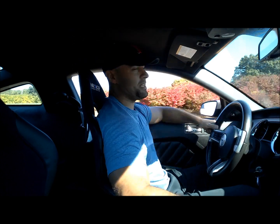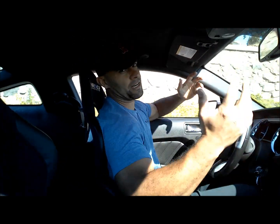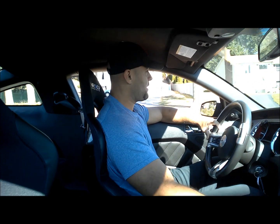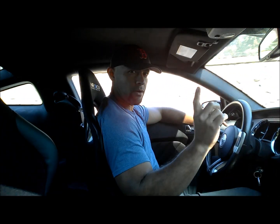So the reason I miss third when I act a fool half of the time is because I'm trying to jam it in gear as the tires are just being fried and it's not letting me. But when you let it wind out and just quick shift it into third, it goes in every time. So I'll do it again. Going about 35 right now. Here we go.